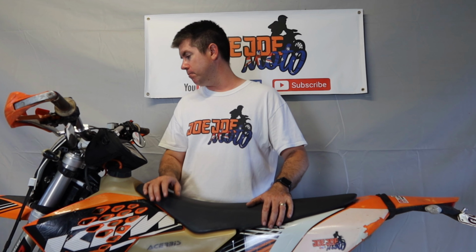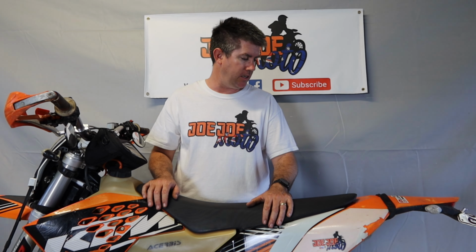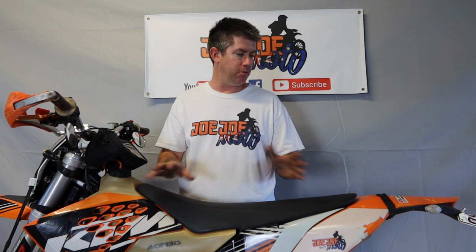But then we've got some bigger maintenance items as well. We're gonna fix up the starter system so that the starter works perfectly every time. We've got some new brake pads and tuning and that sort of thing, like clean the carby, clean the air filter, put new gearbox oil in it, just so it's really ready to go for the new owner. And we'll do a full check over as well, polish everything up and make sure everything's perfect. So that's the plan.